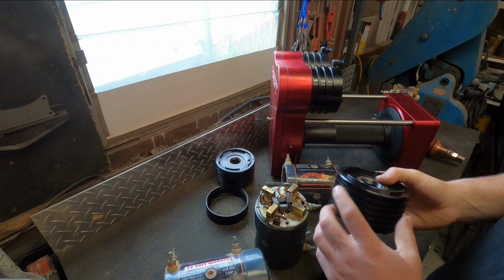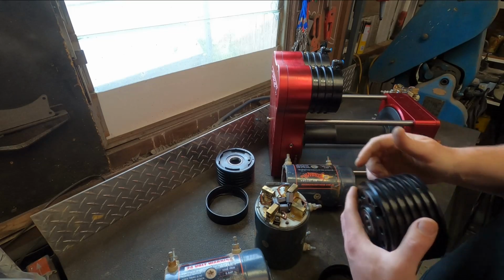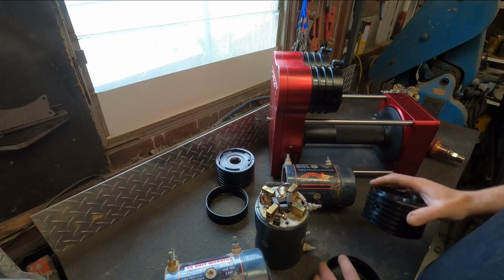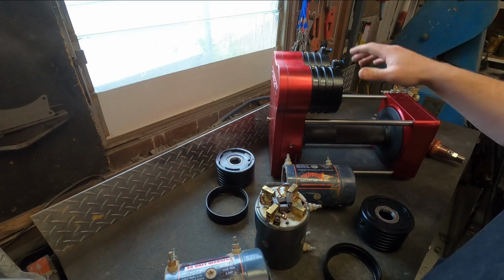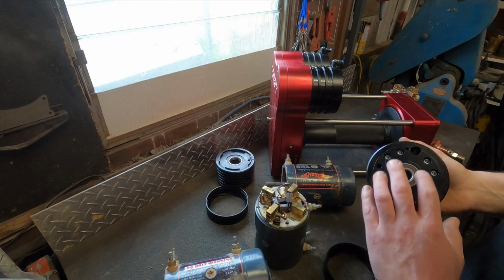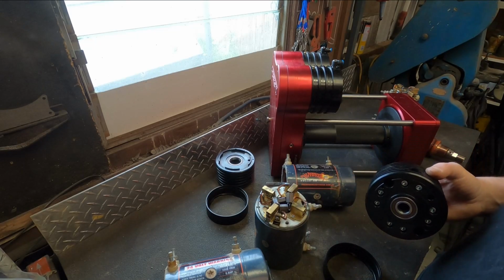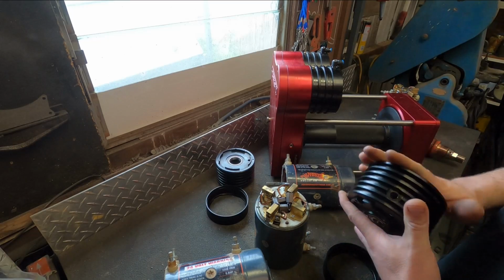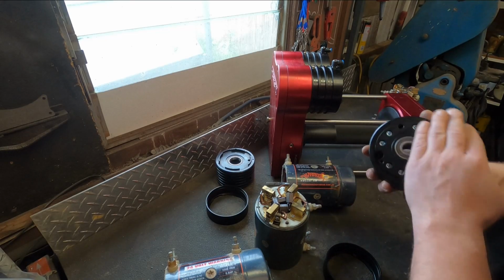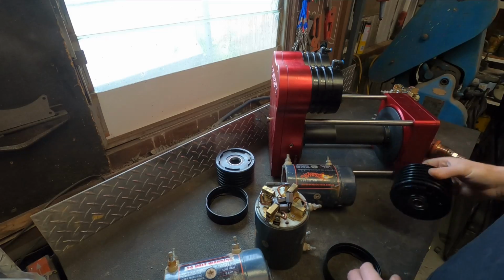So these can be used as a single motor air brake. They can be used as a double motor air brake with another motor into the back of the first one, like we are. Or you can take the disc brake out and actually just use it as a straight adapter. It's unnecessary for us to have 4 air brakes on the one winch, so we're just using the original Redwinch air brakes on here. As you add more stuff, obviously you add some drag, and because this is a competition winch, any point that we're going to lose any motor speed we don't want, so that's why we've pulled them out of here. This will give us a breather port, and we'll just blank off the original air port for that. So these are really versatile little jigger. They have a cap over the back if you're using it on a single motor as well.